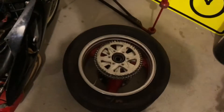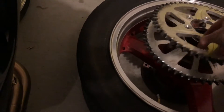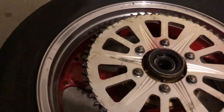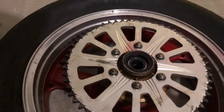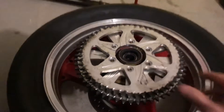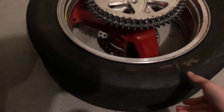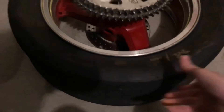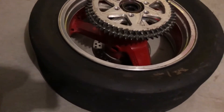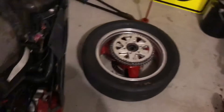I'm going to be getting a CO2 tank and using CO2 in my air shifter. I also got the wheel off. I'm actually going to be putting a different sprocket on it. It originally had a 56 tooth sprocket on it and I have a 52 tooth that I'm probably going to be putting on it. The reason I have the wheel taken off is because the tire is flat and I need to take it to work to air it up.